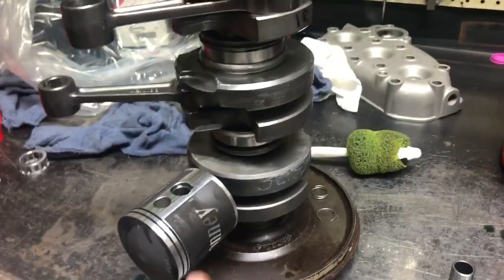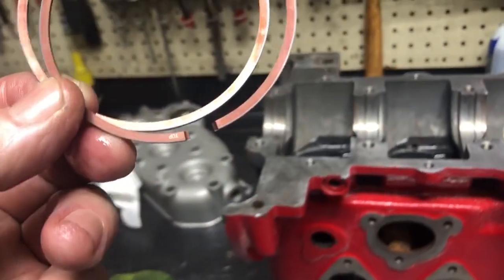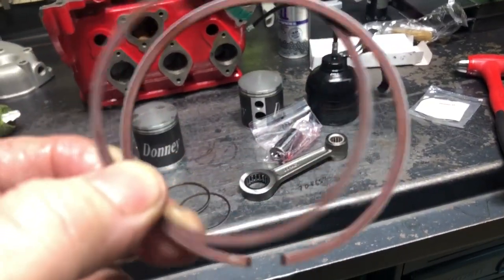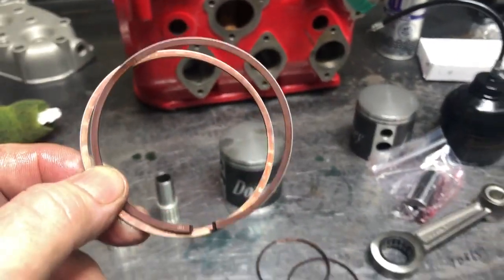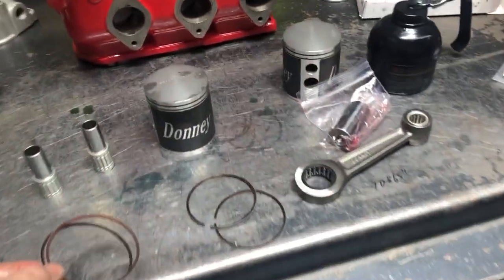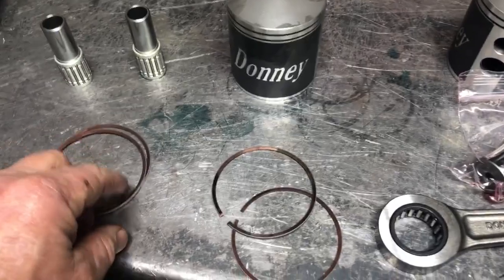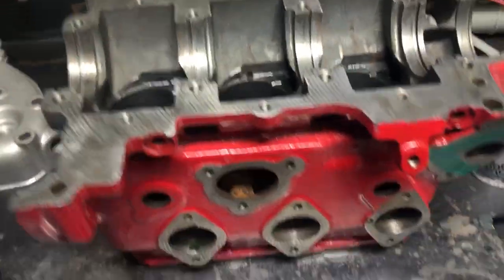You have to put lube on it. Be sure to check your rings in the block for gap. Depending upon what you've got, you're probably going to have 16 to maybe 20 thousandths on a three-and-a-half to four thousandths clearance. If you get up in that five to six range, you're probably going to have 24 to 25 thousandths clearance. The main thing is you have clearance — definitely a problem if you don't have enough ring clearance. Be sure to fit your rings into the top of the block and check your ring gap.